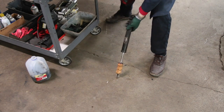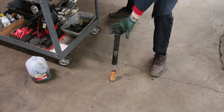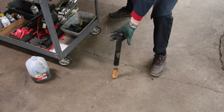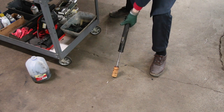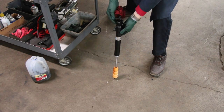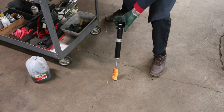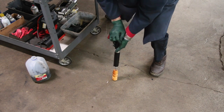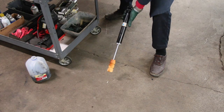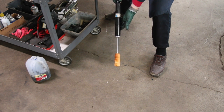Let me show you what I mean by doing a push test. I'm going to push down hard on the one I removed and then release. Notice how slowly it comes back — and I don't really have to push that hard. If you took this off the car and tested it, you might think this shock absorber is okay. But if you compare it with a brand new Bilstein, I'm going to have to really lean into this to push it down — watch the rebound rate. See that? Quite a bit faster, and I'm pushing probably another 20 or 30 pounds to get it compressed. You just can't test shocks by pushing up and down on them, but you'll really notice a difference when you put new ones on and drive the car.